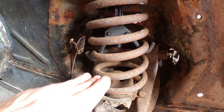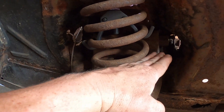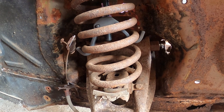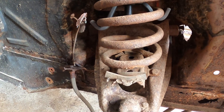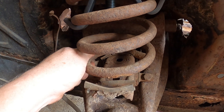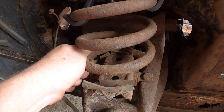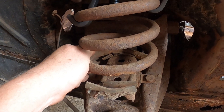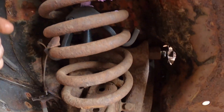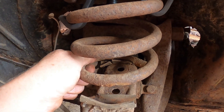They used to make a spring compressor that had a flat piece of metal with a hole drilled in it — you'd slide it in and put the forcing screw in, but I can't seem to find one of those. Keep going, a little bit more. I don't like using an impact on these because it tears up your threads, so I'd rather do it this way. Okay, we're almost off that seat.